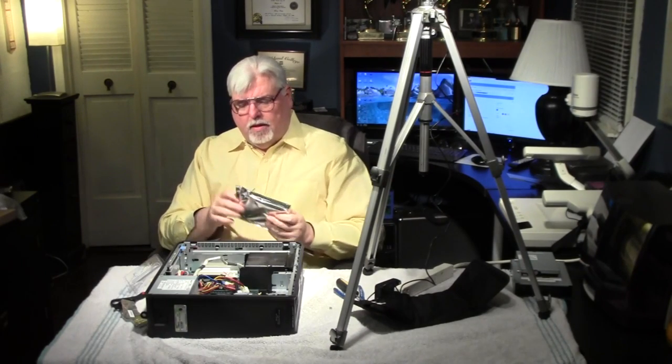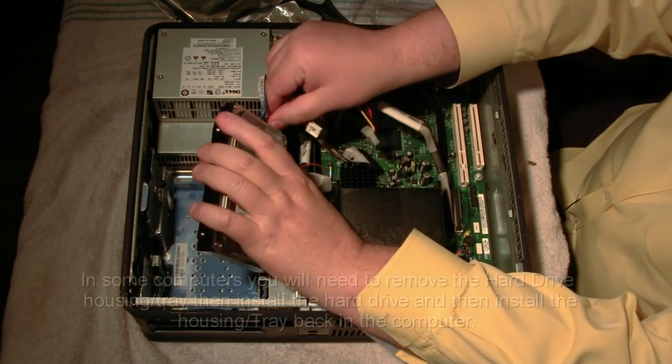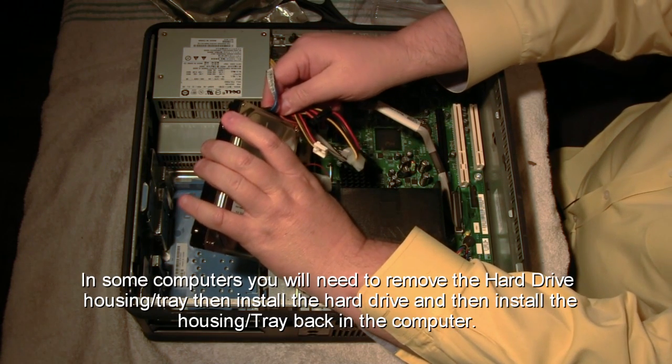That exposes the hard drive. I'm going to put my hand here on this so that I build up static neutrality — electrostatic charge neutrality between the computer and the new hard drive. Sometimes you can wear a wristband with a wire and alligator clip that will help with static, but in this case it's not necessary. Here's the power connector — I'm going to plug that in. This is a SATA hard drive. The other SATA connector is the data, and this one here is the power. They both have to be plugged in.